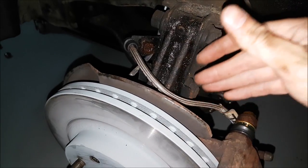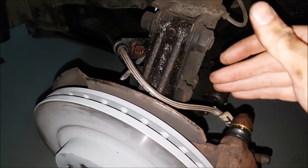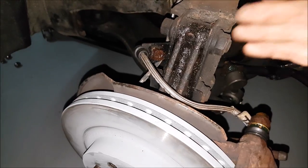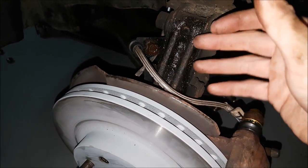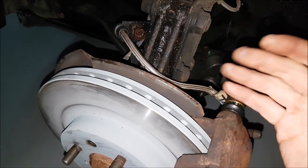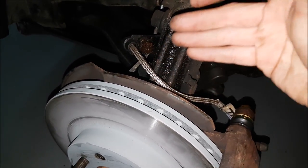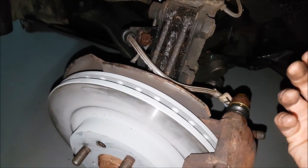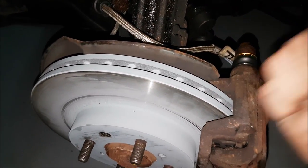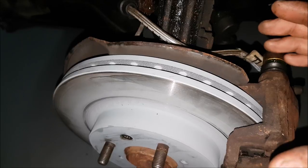We have elected to go with stainless steel braided lines from Russell Performance — my car has Stop Tech, but there are lots of other brands out there. If you have good conditioned rubber lines, they're going to work just fine. The difference is that on a hot summer day this car is less likely to get a mushy feel, because the stainless steel braided line helps the hose maintain its original diameter, giving you proper brake feel. I've used these for about 10 years on other vehicles. Avoiding a mushy brake pedal means you're applying your full effort to the caliper, which squeezes the pads onto the disc creating friction. If it feels mushy, it's not grabbing as hard and you're losing braking power.